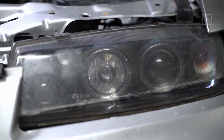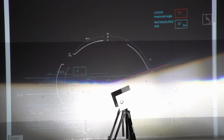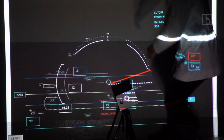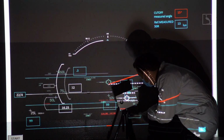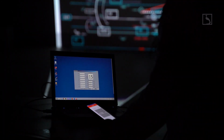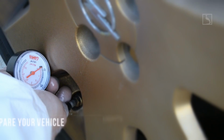Step 10. Tuning with the electric leveling system and horizontal line, first stage. For this, you need one office projector connected to a PC, and one light meter unit, preferably on a tripod. Note we present this solution instead of the optics goniophotometer method, because compared with optical laboratory measurements, this is way more accessible to the wide public. Basically almost any individual, garage or company can do it. With it, the obtained results are very good, and validated by motor authorities.